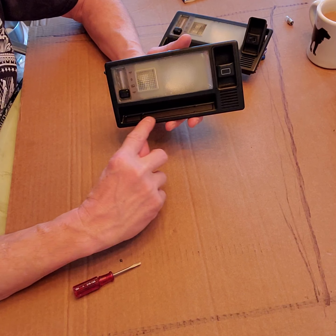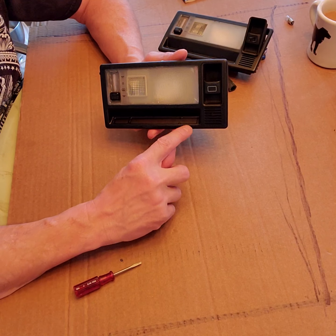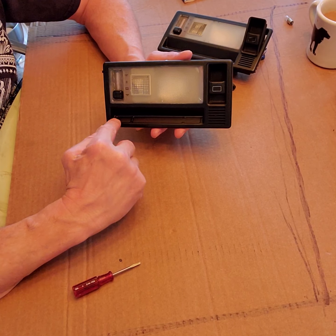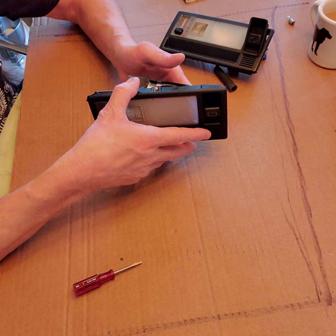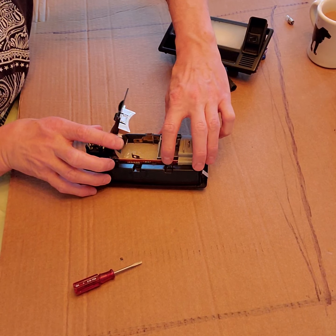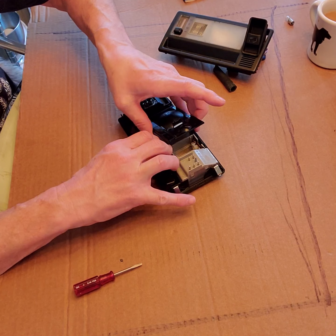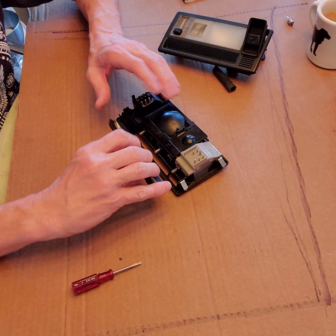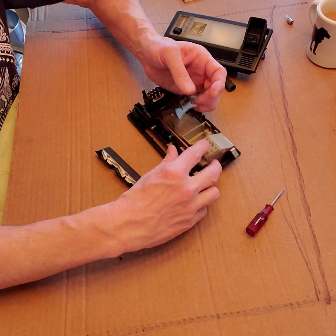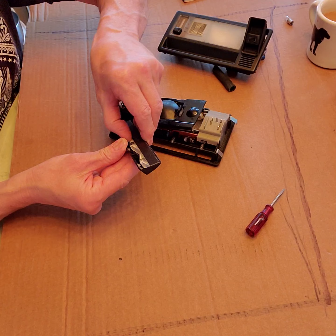This panel is the seatbelt warning thing. It's got a little picture of an unfastened seatbelt, exactly like you'd see in an old airplane — then the passenger and a symbol for the individual with the seatbelt. There are three lights: one for the bulb, one for the driver, one for the passenger. Mine never worked. You get to those tiny little bulbs through this side panel. These little tabs get pulled back and release the panel, but these tabs are super brittle. I really suspect I'm probably going to have to glue some of this back. Inside is a block of clear resin.